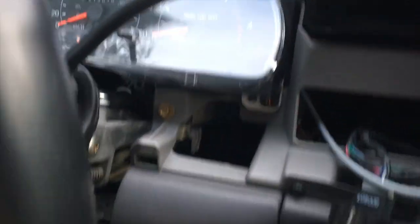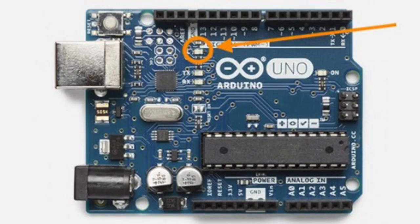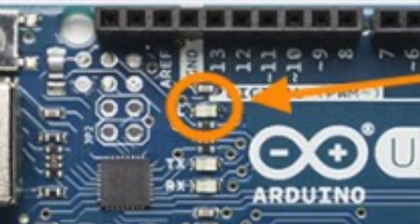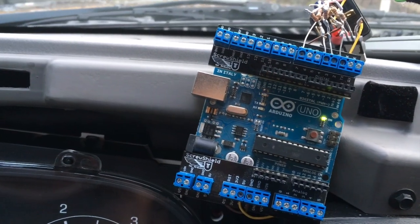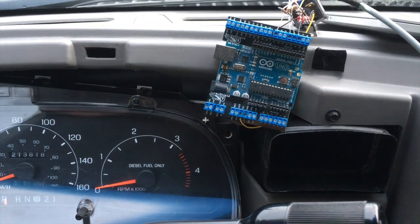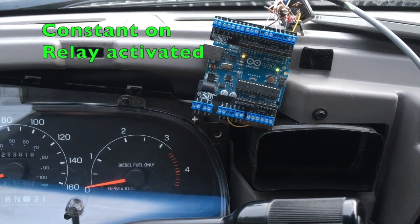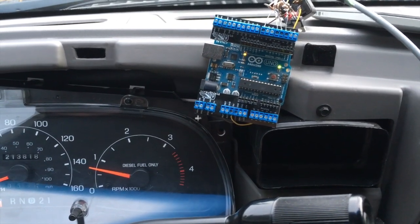So let's test this thing. Here's my key — I put it in the ignition. The Arduino comes with a built-in LED which I programmed to illuminate in various ways to indicate what the device is doing. The LED will start to blink fast once the device is powered up and ready. When I engage the starter with the ignition key, the device should register that and start to flash slower, indicating it's received the start signal and is now waiting for the glow procedure to complete. Once the glow procedure is complete — meaning the yellow wait-start bulb goes out in the instrument cluster — the device will light up a solid LED for as long as the starter is engaged. When the truck fires up and the device reads a minimum set of RPM, the light should turn off.